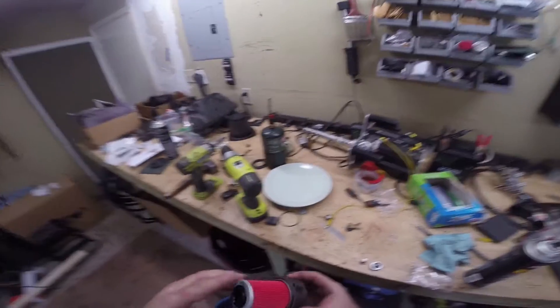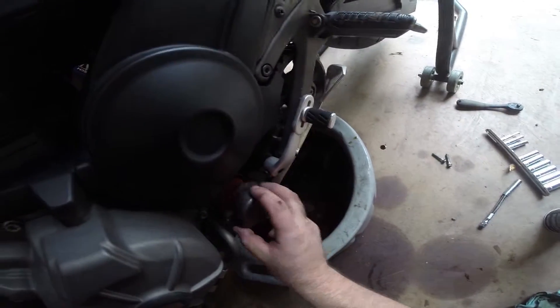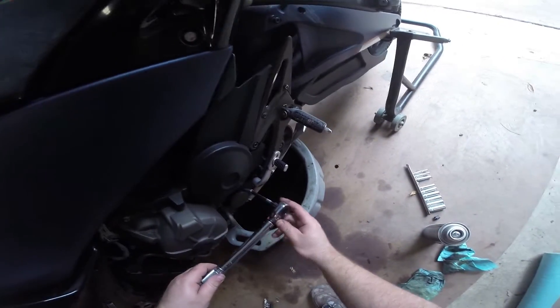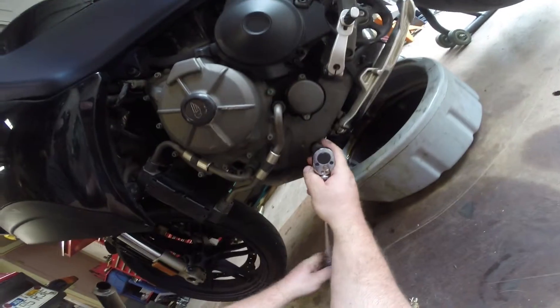Just take this and roll on the new O-ring. Put just a touch of oil on it — it's in there. I like that design; this one actually holds the filter in place quite nicely. Touch of oil all the way around this gasket — helps prolong the life of the O-ring — and then put our filter in there. We'll tighten the oil filter cartridge to 97 inch pounds. The larger one uses a 17 millimeter socket and tightens to 18 foot pounds. This side tightens to 132 inch pounds.